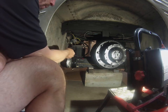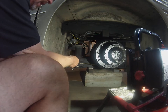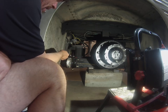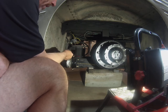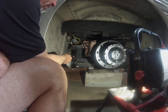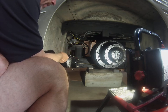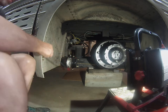You need to cut off one wall of this rectangular tube — the tube is open towards the front of the bus. You cut across, cut down, and cut over. It is not a fun cut: you've got a weld here, this plate is actually welded on top of the tube so you have a lamination there, and there's a weld here where this oval member for the airbag is welded. Below this area is where your jack pad is — a thick pad welded to the bottom of this tube — and you actually slice about half of that away. A lot of people have done it and I have not read of any failure as a result.